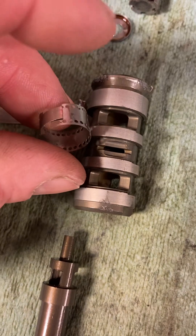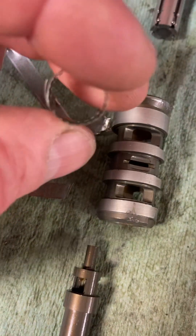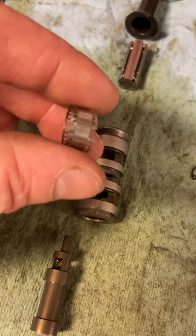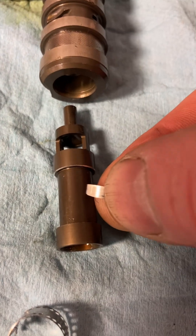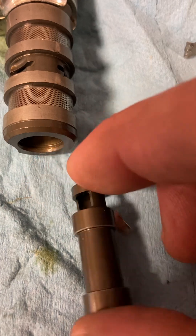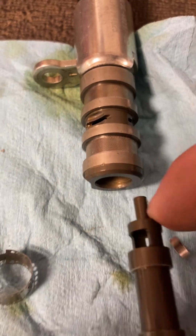Inside this middle chamber is what I assume is an oil control ring of some sort, either restricting the oil coming in or out — I think it's to help it not bleed down. That is actually what caused the failure in the VCT solenoid that had gone bad and was causing the codes, the rattle, and everything. A little piece of that control ring in the failed VCT solenoid had broken off, was sitting in there on the spool valve, getting pushed around by oil, and was chewing up and wedging that spool valve, not allowing it to come down. That was the failure.